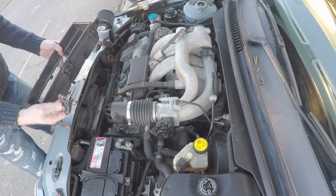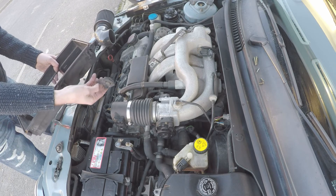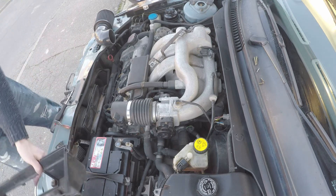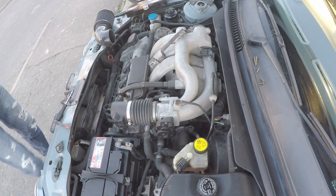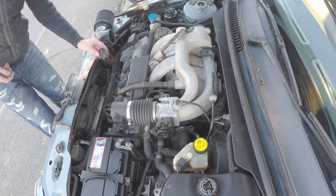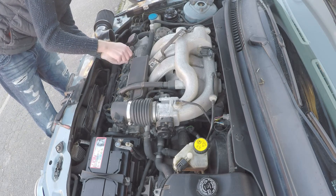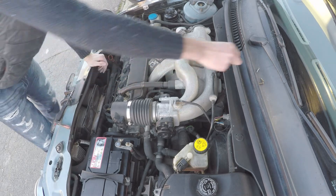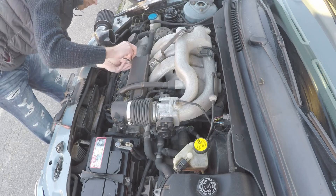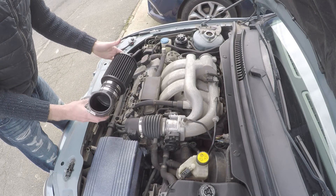You're going to need to cut the old brackets off the back of the airbox lower that you removed from the car, in order to fit the mounting bracket for the engine cover. This will also hold the resonator box if you don't have an engine cover fitted, so it is necessary. They are spaced such that metal spacers aren't ideal, but about an 8 or 10 mm spacer would work if you wanted. If you've got a donor airbox you might as well cut them off and use them.